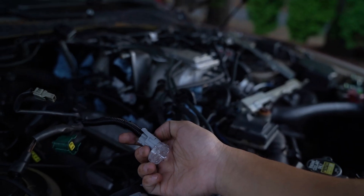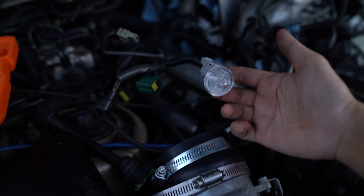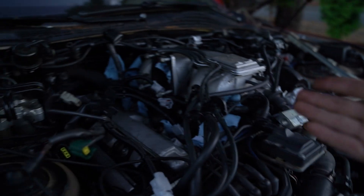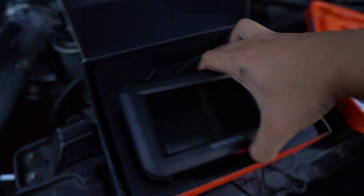That's why I believe I still need to do a head gasket test. What I'm going to do next is make sure none of the cylinders on the passenger side are cracked, because if it's smoking white — which I think indicates a bad head gasket — but that didn't show in the compression numbers, it leads me to believe the cylinders are possibly cracked. The reason I also think it could be injectors stuck or not firing is because of why I had to replace them. After looking through all the cylinders with my camera, I'll have my sister crank it so I can see that all four on the passenger side are firing.